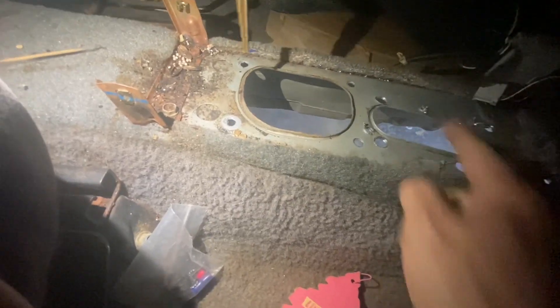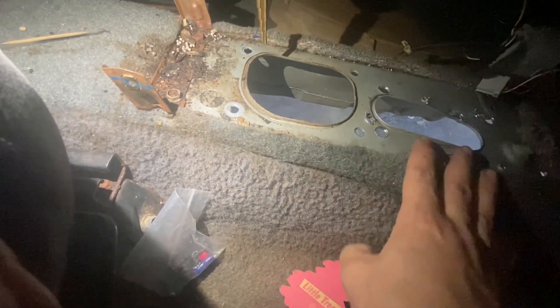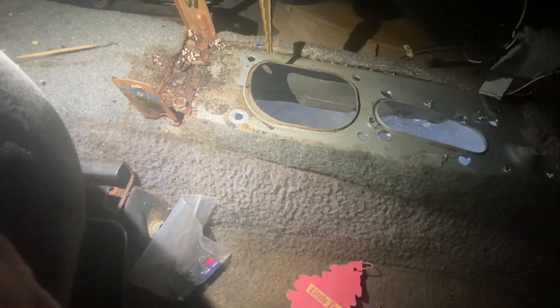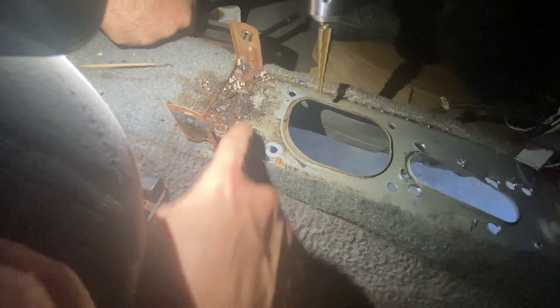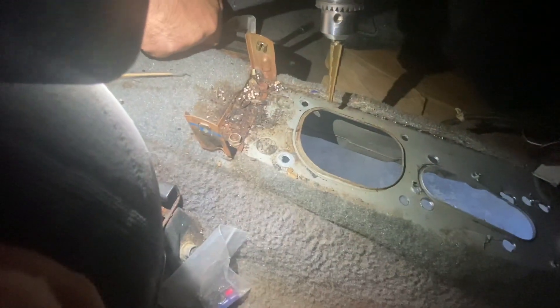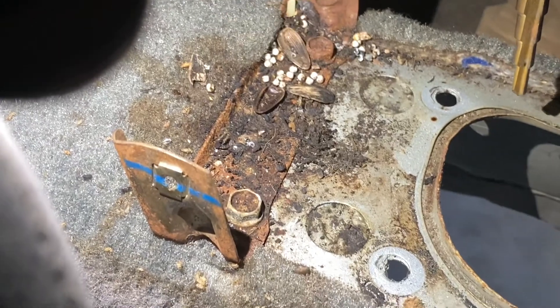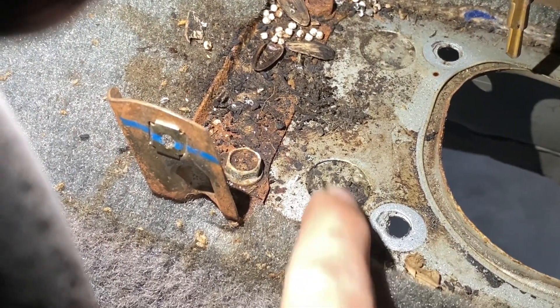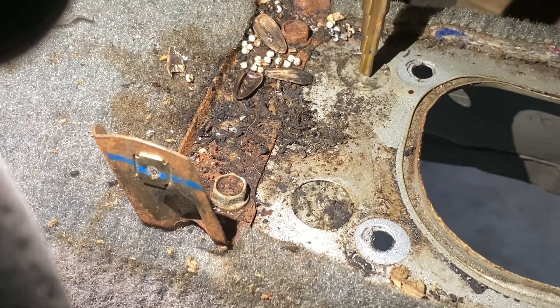On that other setup, once we drilled the area where the automatic main unit was — where the cable things went through — I showed y'all all those holes to drill from the top and then at the bottom. Now we're putting the shift linkage back in. There's a dimple here and a dimple here — that's going to be where the new shifter bolts go. He's going to go ahead and start drilling into that.